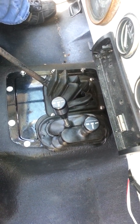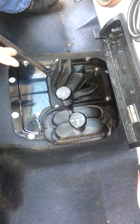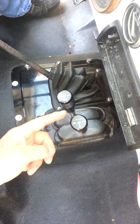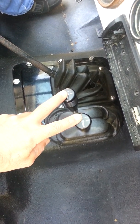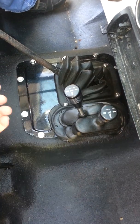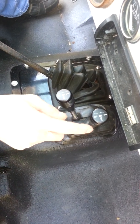If you want to go into four-wheel high all around, just move this back — which is the way I typically drive it on the road. Always start with this one first. If you're in gear with both axles, start with this lever and put it in neutral.